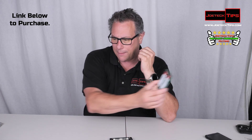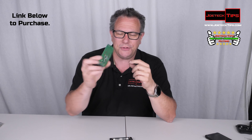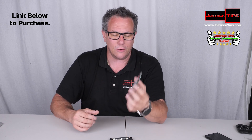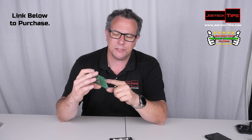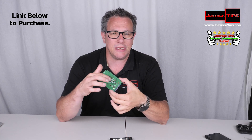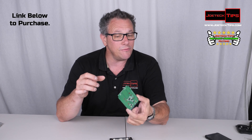You could use this in a NAS — you can set up RAID 1 with two of these in a NAS for a two-disk array. Even with a single disk, as we showed in a past video, this product actually works better than the other one, because as soon as you set it up for RAID 1, it's detected on the PC correctly. This thing works great because of the hardware RAID controller built right on the board. I'm very impressed.